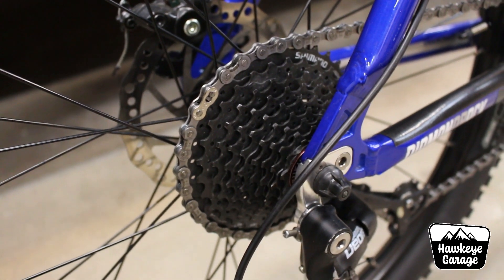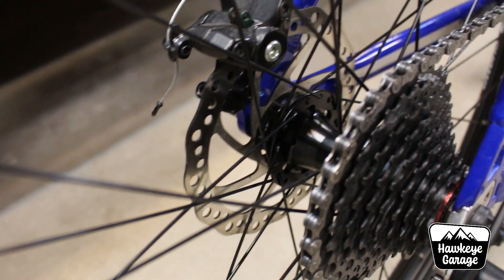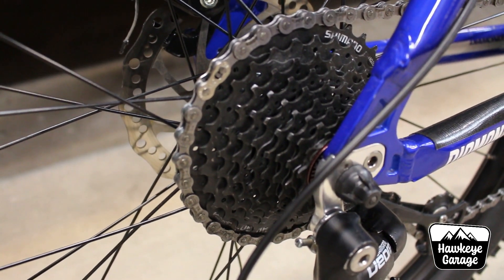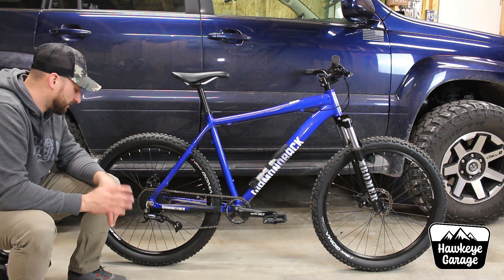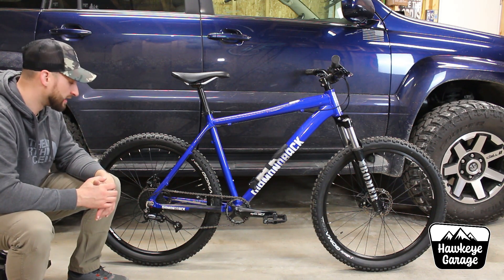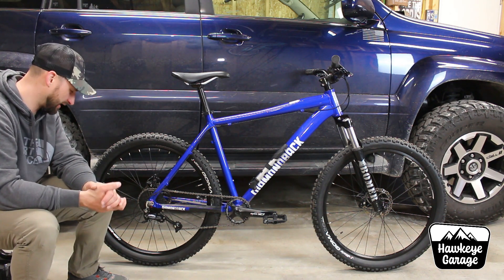This wheel didn't have a free hub on the back originally, so you couldn't change the cassette — the cassette being the unit of sprockets on the rear. So I went ahead and unlaced the wheel: took all the spokes off, removed the hub, got a new hub with a free hub that allows you to swap cassettes, and laced it all back up. It's not intimidating at all. If you're mechanical enough to work on your own four-by-four or your own bikes, find a YouTube video. It's a little tedious but just sit in your living room floor in front of the TV, watch a video, take your time. You don't need any special tools or a spoke wrench — get them finger tight, tighten another quarter turn with a screwdriver, and take it to your local bike shop. They finished setting it up for me for $23, and now whoever buys the bike can change the cassette to whatever arrangement they want.